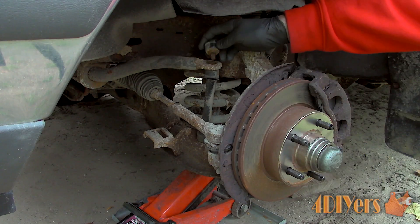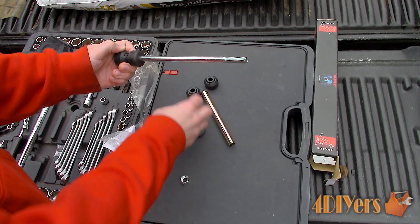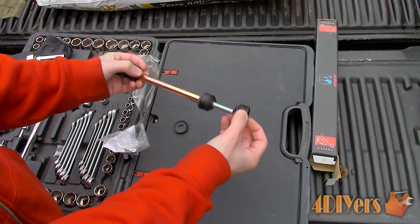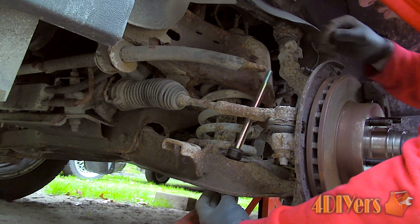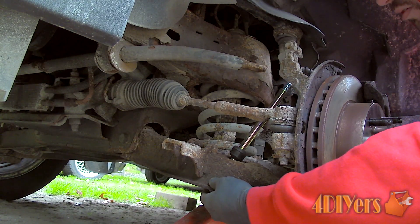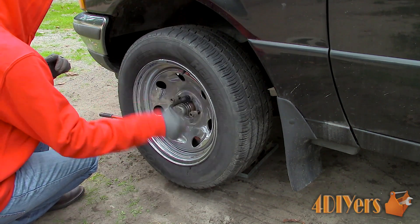As a tolerance value between the tire tread wear measurements, this can vary between manufacturers and drive systems as well. From some manufacturer specifications: Audi states that the rolling radius of all four tires must be within 4/32 of an inch. The Porsche Cayenne must be within 30% of the opposite wheel on the same axle. And Subaru must be within 1/4 of an inch of tire circumference, or 2/32 of an inch of each other. If these values exceed these limits, this can cause premature failure of drive components and faults with the vehicle's computer, as each wheel will be turning at a different speed.